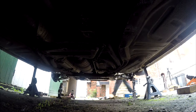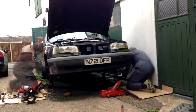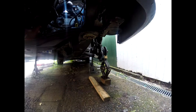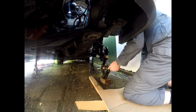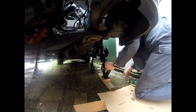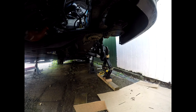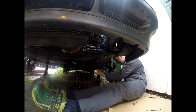When you're jacking up the hubs to set the neutral position for the lower arms, you really need to be very careful. As you put the jack underneath and compress the springs, you're actually putting load on those springs and effectively lifting the car off the jack stands. If the car isn't properly supported, you could end up lifting it on a single side and the car is going to want to rock. As Greg was jacking up one side, the car did start to move. We caught it very quickly, put the jack back down, lowered the car onto the stands, and re-secured it. Safety first — always check the car is properly supported, because the consequences could have been disastrous.